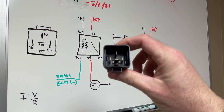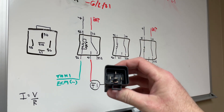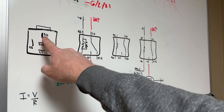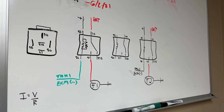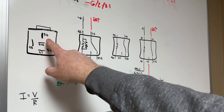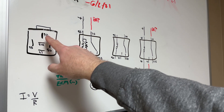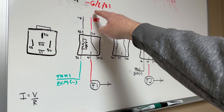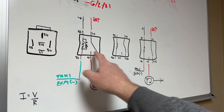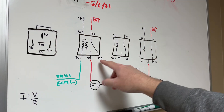Over here on the left we have drawn the bottom of a relay with the mounting bracket up, so you can see the pins — they all line up with the diagram here. As far as I know, all Bosch style relays have this same orientation with the 30 pin being nearest the mounting bracket. So let's start there: the 30 terminal on a relay is your battery feed. On mine I have a 40 amp circuit coming from a bus bar, fused, coming in through pin 30.